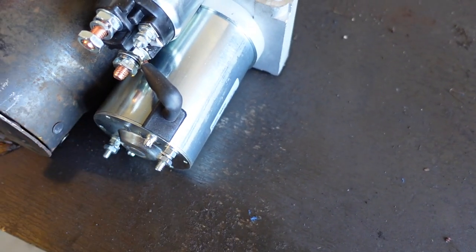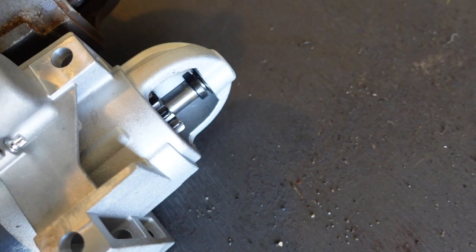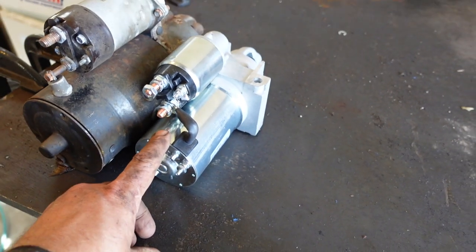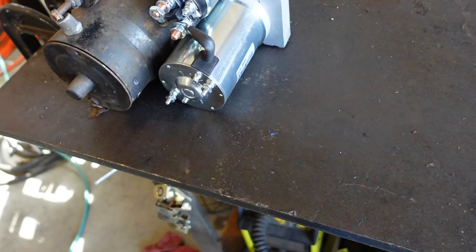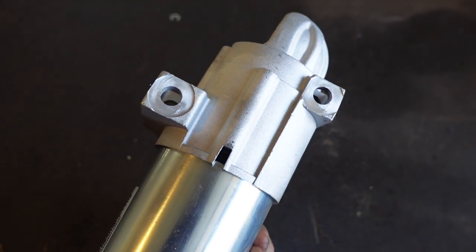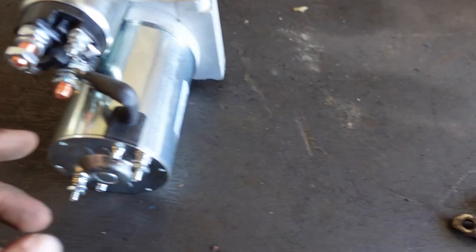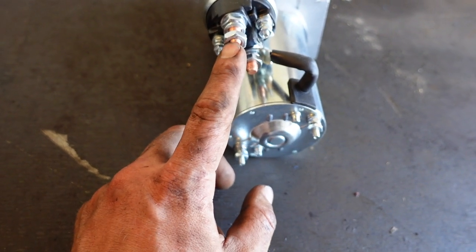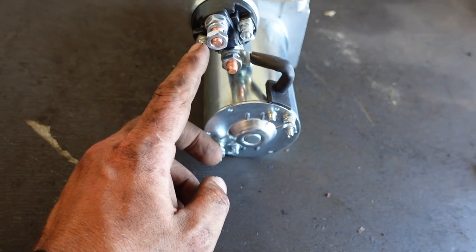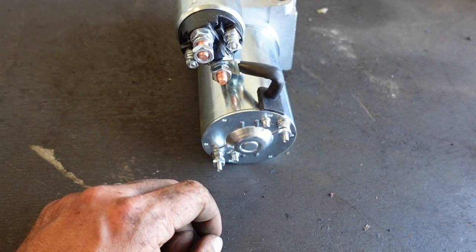Here's the new starter — it is a lot smaller, which will make it easier to go in. The bolt pattern appears to be the same, and the depth looks the same, so maybe new technology. I bought this on Amazon and I'll link it in the description below — it was like 75 or 80 bucks. Those two bolts just go vertical up into the block on the bottom, so it's not too bad — 9/16 head. This is where the wiring goes: the hot lead goes here, and then the purple wire and brown wire — one of those is the exciter. Pay attention when you're taking it off so you get them in the right spot going back in.